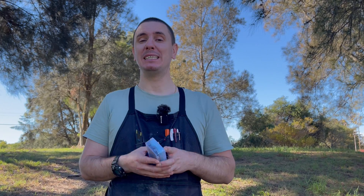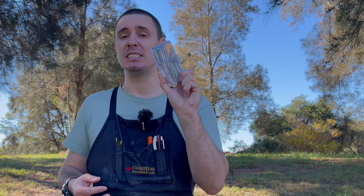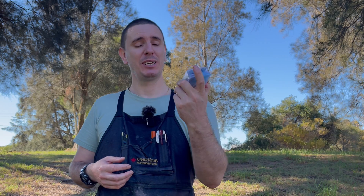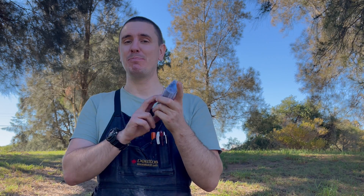To remove and replace both of these check valves, as well as the Welsh plugs and many other parts that make up a carburetor, we're going to use the service kit. These are sold by both Walbro and Zama — I'll put a link to those in the description below. They do come as separate kits but I've just combined them into one.